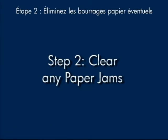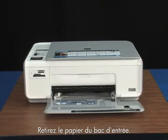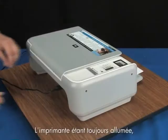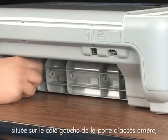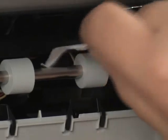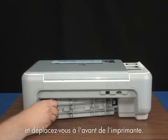Is the printer still not working right? A paper jam might cause your carriage jam. Clear the paper jam from the back of the printer first. Remove the paper from the input tray, then turn the printer on. While the printer is still on, unplug the power cord from the back of the printer. Press in the tab on the left side of the rear access door and take the door off. You should be able to see the jammed paper in the rollers — gently remove it, making sure you get all the pieces that might tear off. When you've removed the paper, replace the rear access door and move around to the front of the printer.